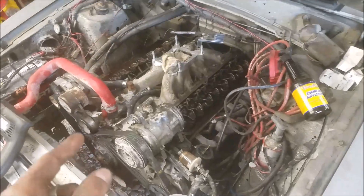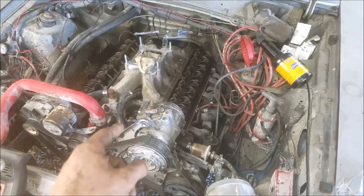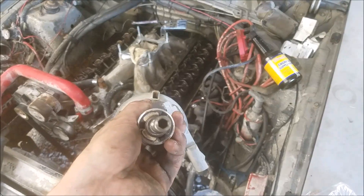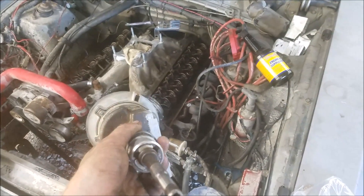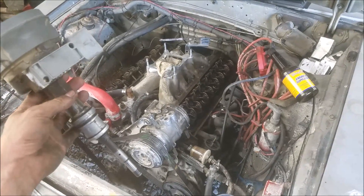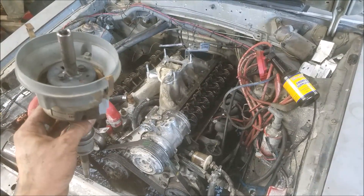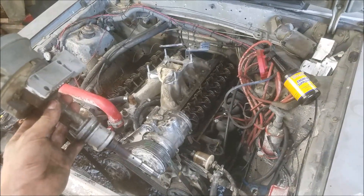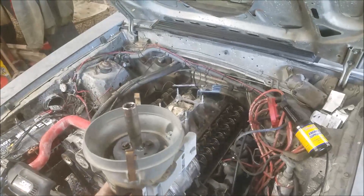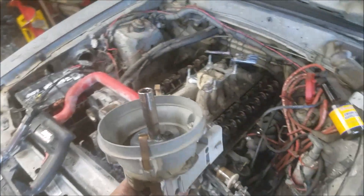The Chevy is a lot easier than the Ford because the Ford oil pump drive shaft is a hex instead of a slot like the Chevrolet. The easiest way I've found to prime the old Ford system — and I do this for Chevrolet builds as well — is to take an old distributor that's pretty much worthless and convert it to an oil pump driver. You do this by simply knocking off the cam gear off the bottom and then mounting something you can hook a speed handle to, or today we're going to use a drill.